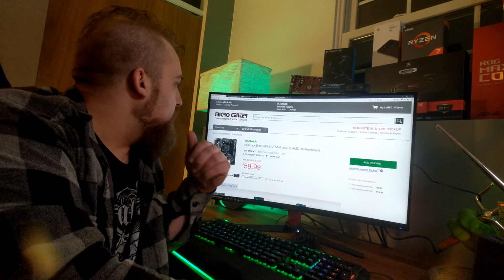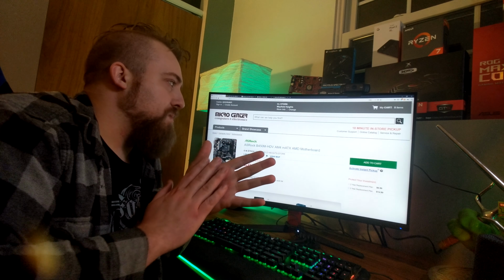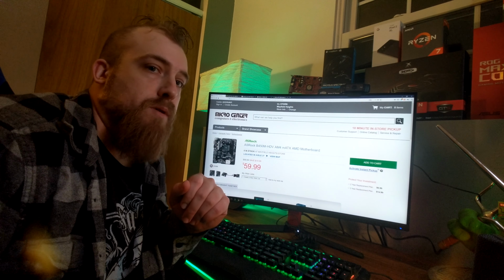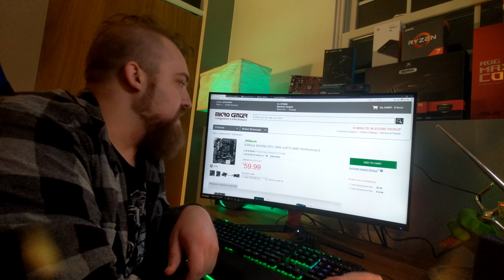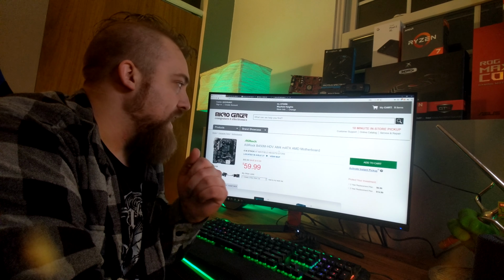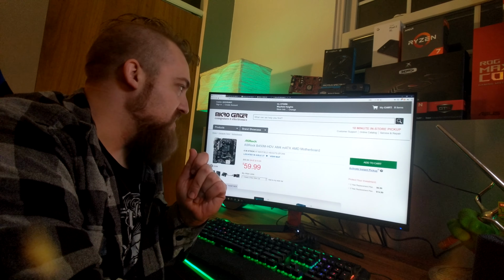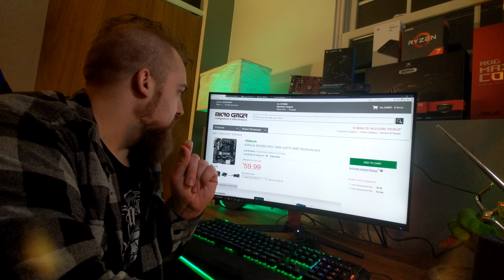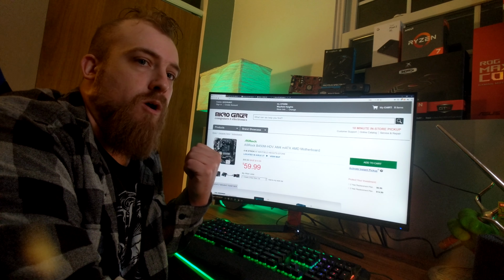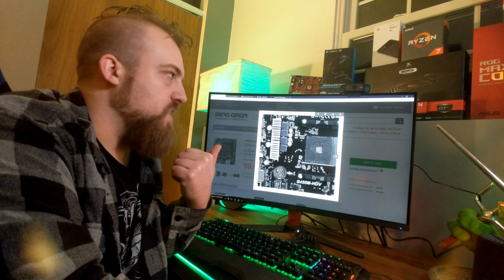And then over here at Micro Center, I found the cheapest motherboard. It is a Micro ATX motherboard, so we do know it is going to fit in that Micro ATX case. And this comes in at $60, and it's an AM4 motherboard, the B450M HDV. Now, this is a budget build, so I did cut a lot of corners, so we probably won't want to overclock on this motherboard because the heatsink on this thing doesn't look so great.